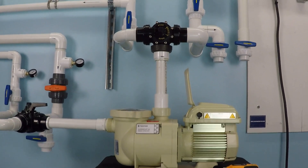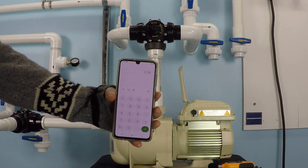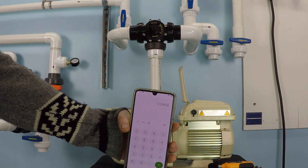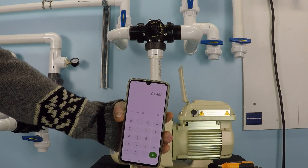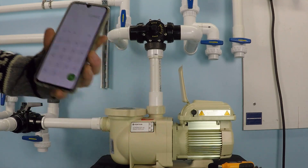Let's do something with those numbers. It was 0.36 kilowatt hours that it was using — if this thing ran for an hour like this, it would use 0.36 kilowatts of power. The nationwide average price for electricity is 13 cents per kilowatt hour. So we take 0.36 times 13 cents — you're looking at just over 4.5 cents per hour. It's really low.